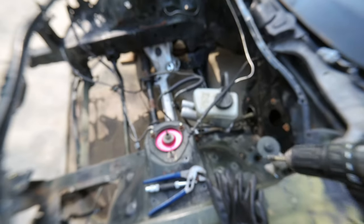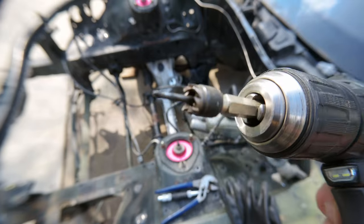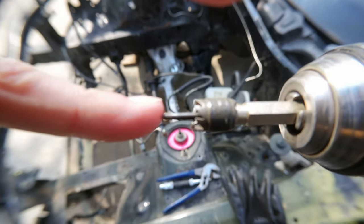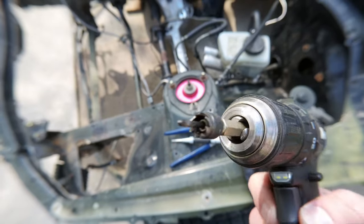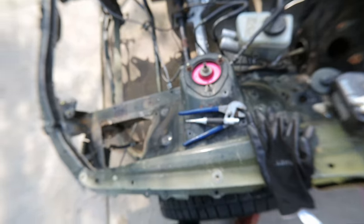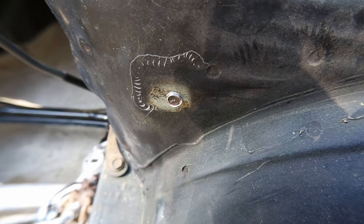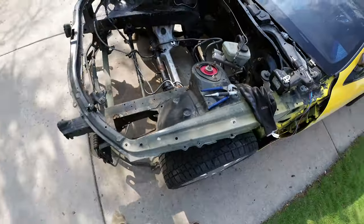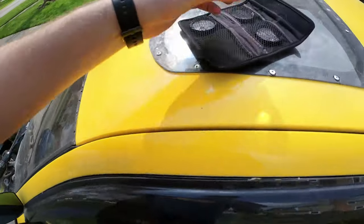This is gonna look a little trippy, but I got this new lens that I can finally show you guys up close. This is what I'm using to drill out the spot weld. So you just, you know, punch, then this goes in that point. It's like a little hole saw. And it saws the weld off, and then you can just use an angle grinder and zip that off the rest of the way, and there you go. You got a nice, clean little spot. Lens attachment thingy, so I could actually show stuff up close until I get a new camera.